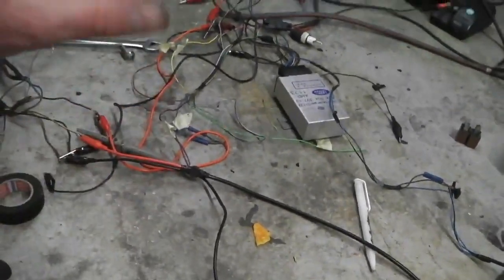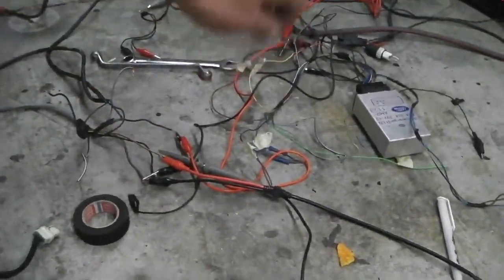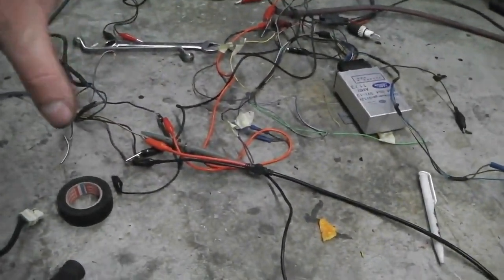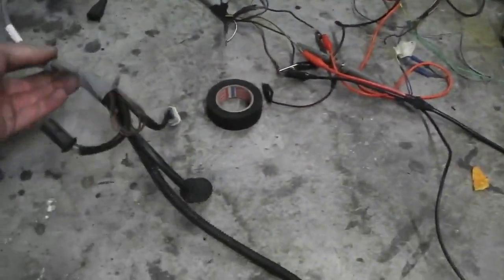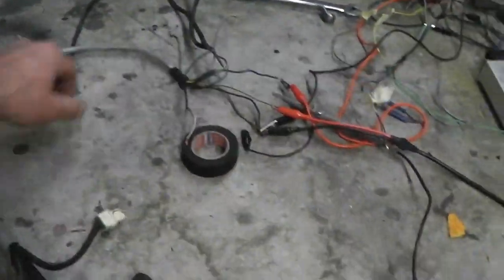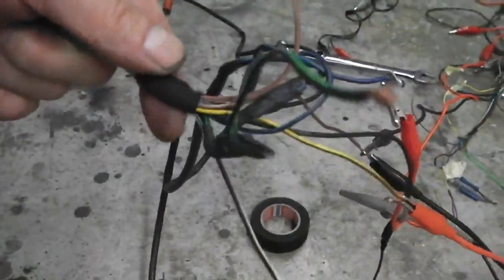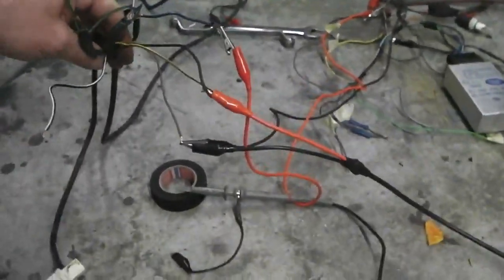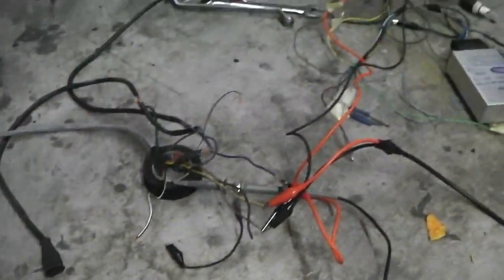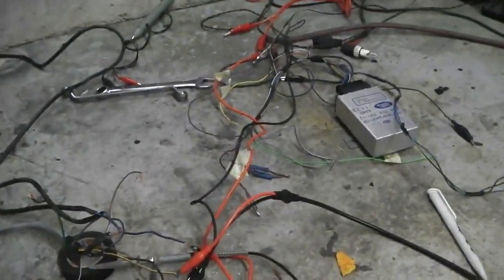It's time to neaten up the cables. We've got ourselves a rat's nest of messy wires. That's because I'm dropping croc clips in and just learning about the system. And then once I'm happy about it and I'm confident that it boots up every time, then I start to make the wire wrapping. So we've started by heading up this way, and I terminate the end of my grey loom tape with some Tesa cloth tape, ready to make my next set of connections here. There's this kind of breakout area here. It's time now to build a bit more of a loom to tidy up the cables, to get ourselves a couple of little controls, and then take this across to the engine and hook it all up and see what happens.